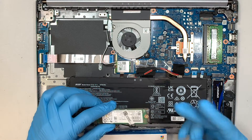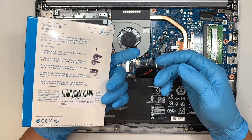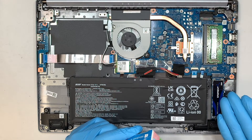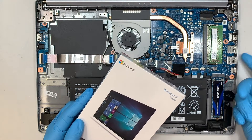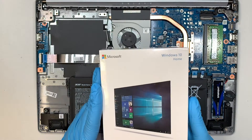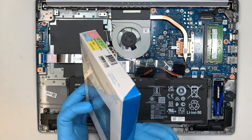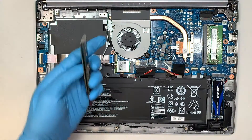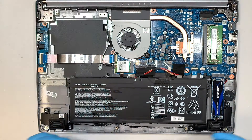Option two is you go ahead and buy yourself a brand new Windows 10 USB installer. Once you install the hard drive, if you want a fresh brand new Windows install, buy one of these and plug it into the USB and do the fresh Windows install. If you don't want to buy this, you can actually go to the Microsoft website and create yourself a bootable USB drive with Windows on it, boot it, and reinstall Windows yourself, so you have a fresh Windows install on your brand new hard drive. Later on, you can also use one of the tools with the original drive to transfer your pictures, music, data, or whatever back into the new drive.